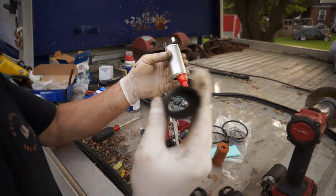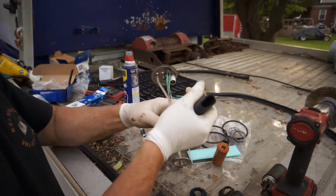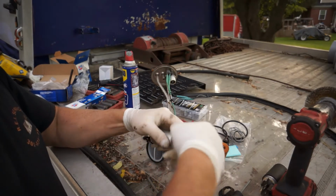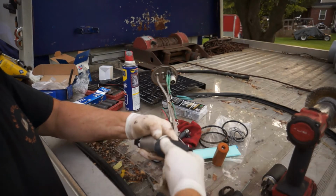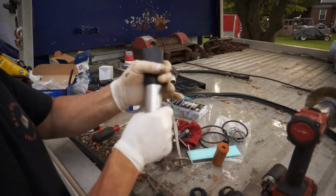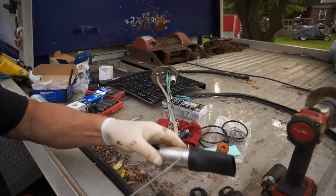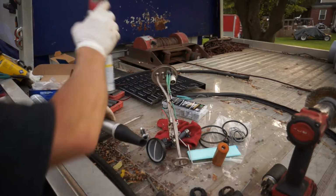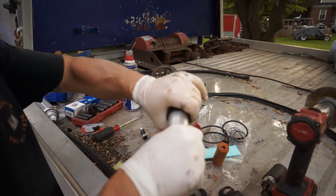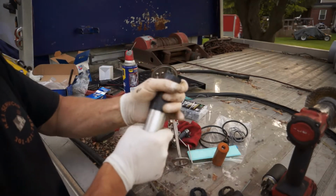First, I'm gonna get my little insulator cup that goes around this thing, which can be a little bit of work to muscle on. It's kind of like an insulator. It keeps it cool. Believe it or not, these fuel pumps are down inside the gas, and the gas keeps the fuel pumps cool. So sometimes I don't want to spray a lot. I'm going to spray a little bit of WD-40, or you can use soapy water or something like that. Just enough to get down in there, just to help me push this up on top there, because it is already starting to get stuck on there.